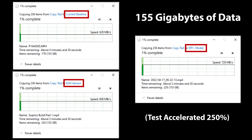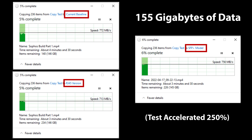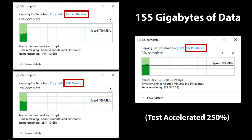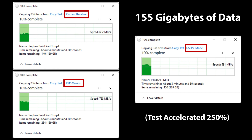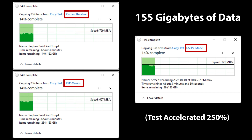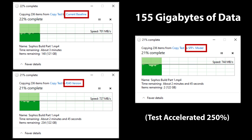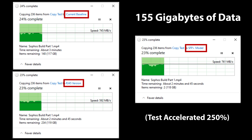Now that we've seen the cards let's do some testing to see how they perform. I'll use a standard file copy with 155 gigs of data to measure throughput as a comparison between my current setup and the two LR Link cards to see if there's any significant difference in throughput. This is not meant to be a comprehensive test under a variety of conditions, but rather to test the throughput against my current baseline.